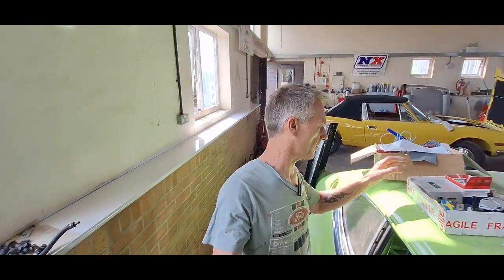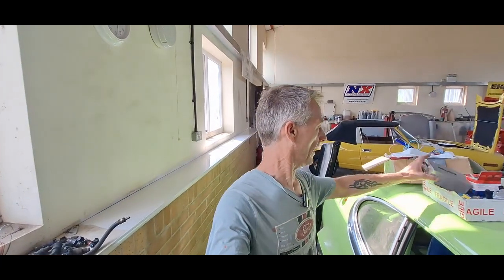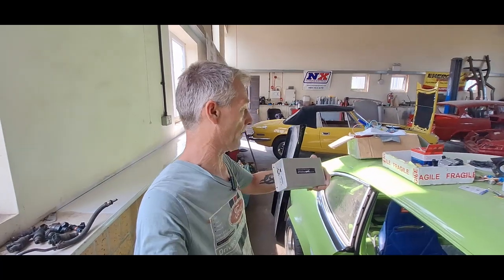The ECU — I've got friends who build them and people who've used them before. So what I've bought is a Megasquirt ECU. This is an MS2 with an MS3 board in it, because it's got data logging. I bought this as a kit online from a company called X3FI, who do a Rover-specific kit. They aren't sponsoring the video — I'm not recommending their stuff, I haven't even used it yet. I'm just saying they seem to have a very complete package.